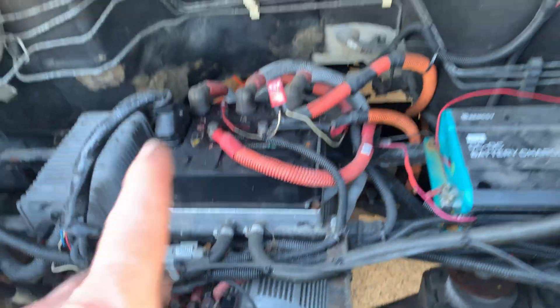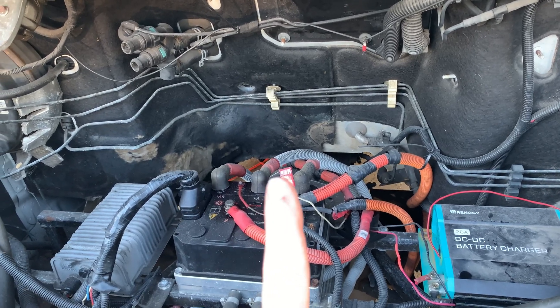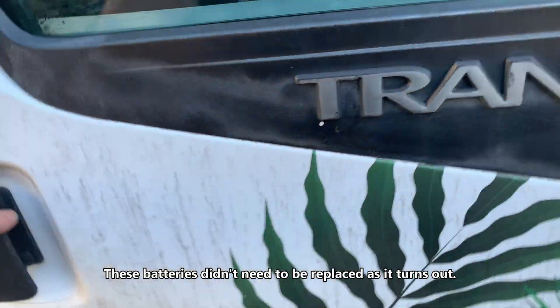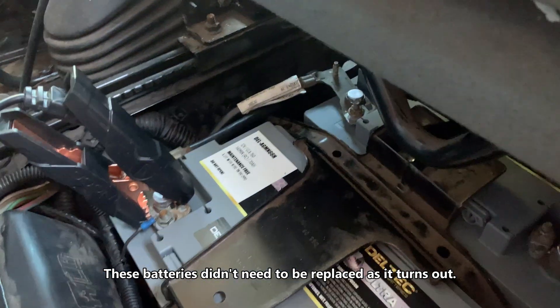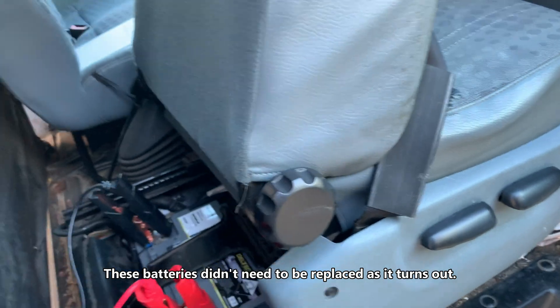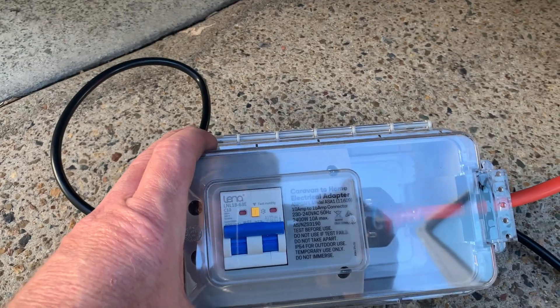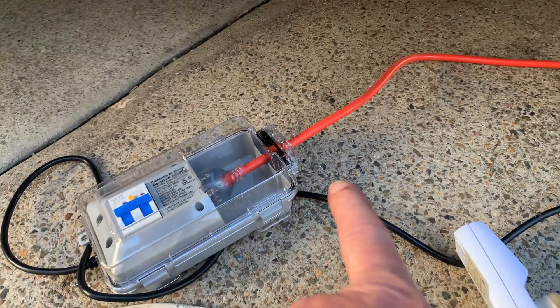Before we can work out much, the traction battery is completely flat. The two 12-volt batteries inside the car have been replaced already — my older brother went ahead and did that. There are batteries underneath and he's got a charger on it, but unfortunately it's not doing much. Those two new batteries are charging — they're the car batteries. We've got a caravan-to-home adapter to try and charge the vehicle.